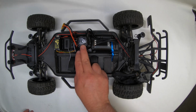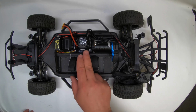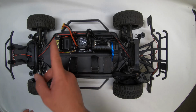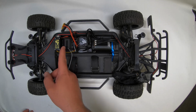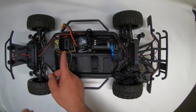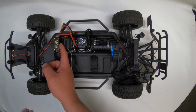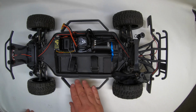The Copperhead ESC combined with this longer can motor didn't exactly fit straight into this truck. The can being a little bit longer and the ESC longer than a few of the others out there, the receiver box wouldn't fit. So I had to unbolt the receiver box, drill new holes in the bottom of the receiver box, and move it a quarter of an inch forward and remount it down. Then I had enough clearance front and rear, and the lid on the box will still open without binding against the servo, but it has to be moved for a longer can motor.